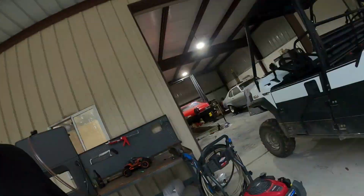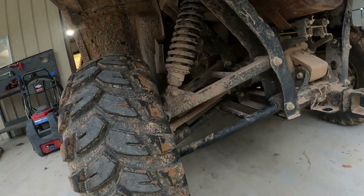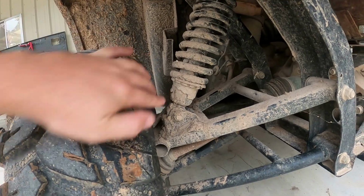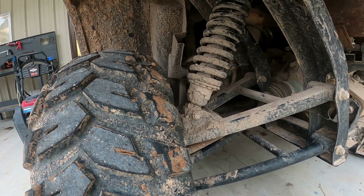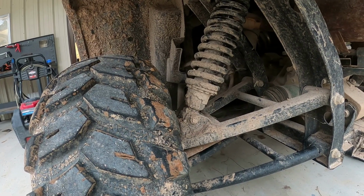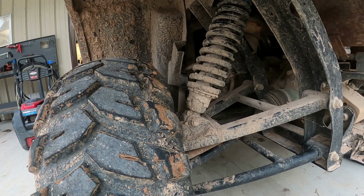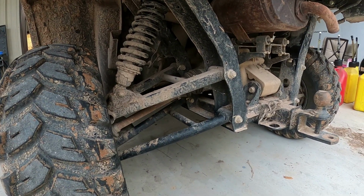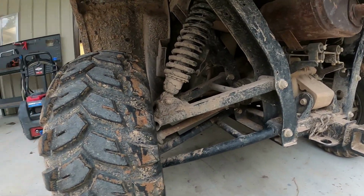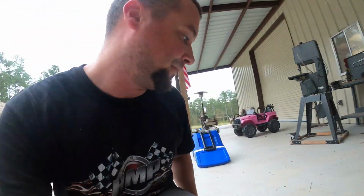And I don't know, maybe I can turn this little suspension knob up and get it to sit a little higher in the front, or maybe even turn the front down just a little bit. Because I do some towing with this thing, so it wouldn't hurt to stiffen it up in the rear. And that actually might be why it's squatting a little bit in the back. But anyway, that's the install for the 3-inch Rough Country lift brackets.